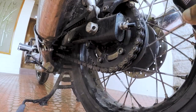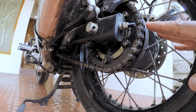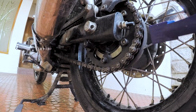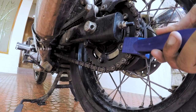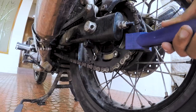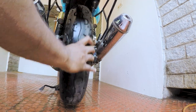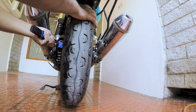We'll leave it for ten minutes and then come back with the brush. This is the brush we are going to use for completely degreasing the chain. Attach it anywhere on the chain and start rotating your wheels slowly. One important thing — please do not put your vehicle in first gear and rotate the wheels using the accelerator. Instead, do it with your bare hands. This is the safest method and will help you avoid injuries.